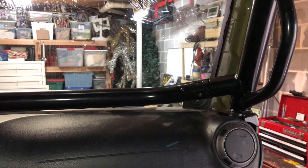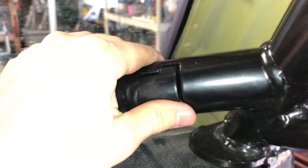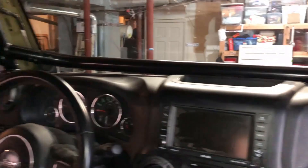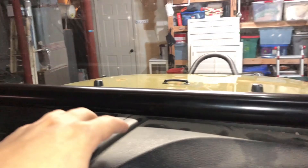I've got the factory sun visor 13mm bolts in on both sides, just loosely. The crossbar is in now — the cage still needs to come up just a hair, but I didn't want to do that until I got these bolts in. It's a weird fit but hopefully the bolts will go in fine. I'll snug everything up and then drill the holes after, doing all the factory fitment first before any permanent drilling.